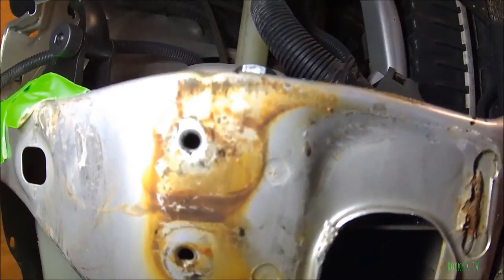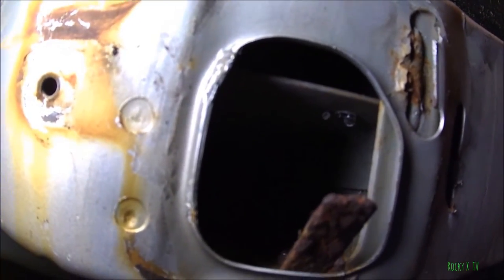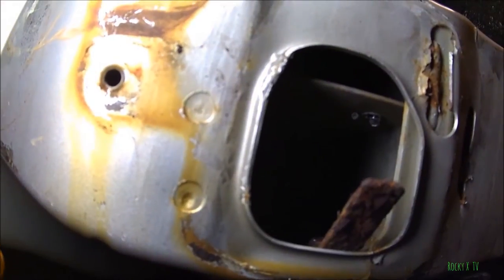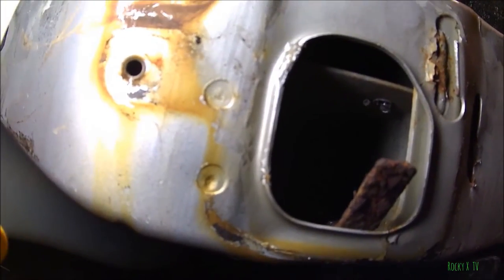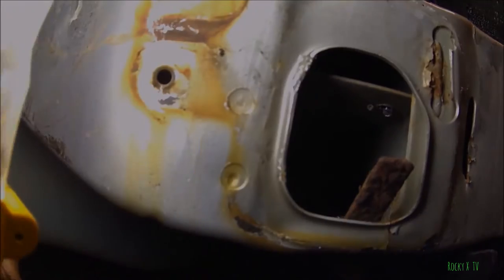I can continue to drill through, but the problem is I will hit this plate that's in here for the tow hook. And it looks like it'll be right in the way of this bolt here. And I want to keep the tow hooks. So I think I'm just going to use really long bolts on the outer ones that go all the way through the big washer on the bottom. It'll be covered up. And then I'll drill that out inside there to fit the 3/8 bolt, and I'll just run a shorter bolt and put a nut on it from in there. So I'll just have long on the outside and short on the inside. So I'll see if I can set you up and let you see how this works.